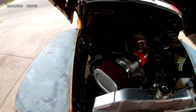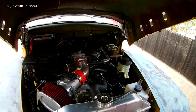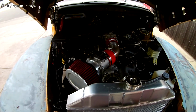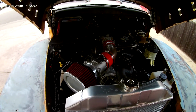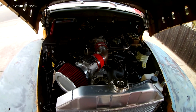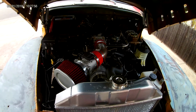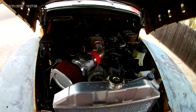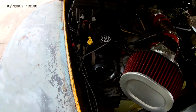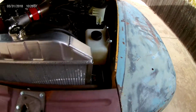We've used the stock Ford 98 harness. All the emissions equipment is still on the truck, just repositioned. If you look underneath the hood of a 98 Ford, the breaker box and everything is on the opposite side, on the driver's side versus the passenger side, and same with the mass air sensors, flipped in order to fit it into the truck. It's a tight fit. But as you see, everything does fit nicely.